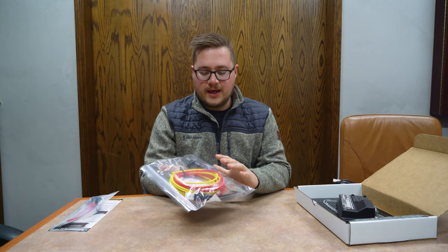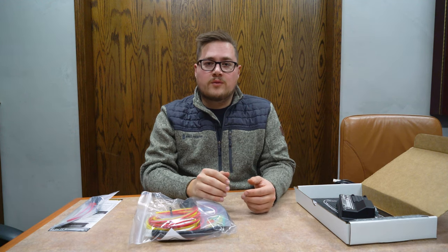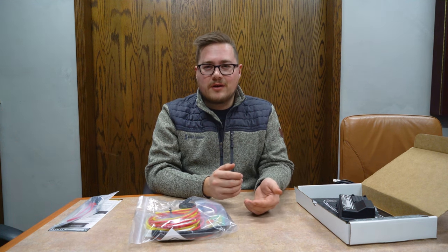Bob will show you how that works in the software explanation that follows. The PWM controller can control a single fan or dual fan setup. If you're planning on running a dual fan setup, you'll most likely need a fan relay harness. This includes a relay, a fuse holder, and everything you need to wire up the secondary fan. The first fan runs primarily off the PWM signal, and the secondary fan kicks on when the motor reaches 100% speed.